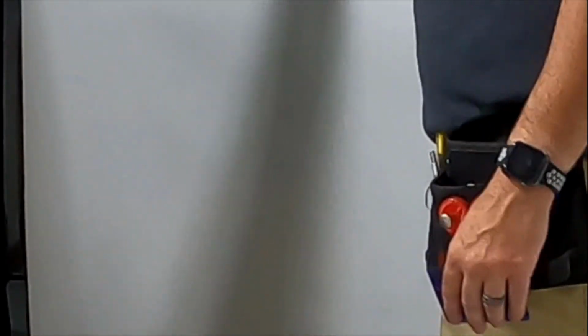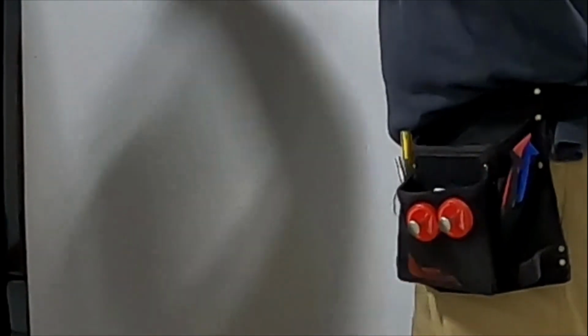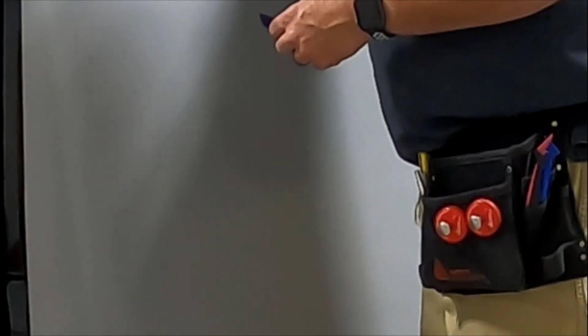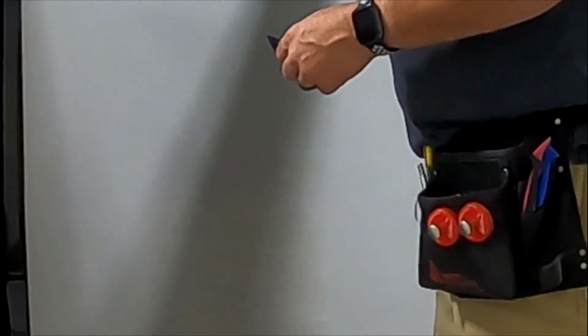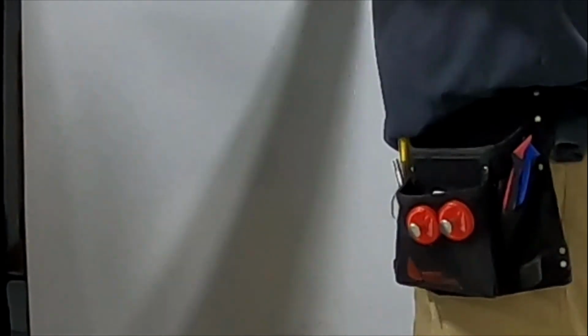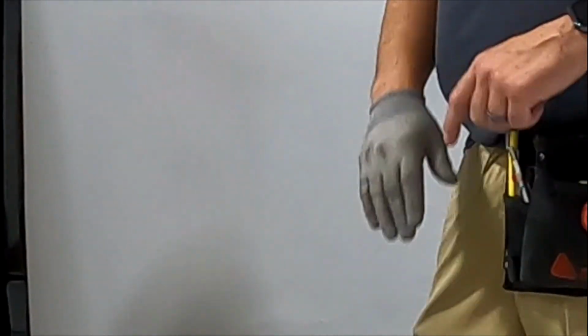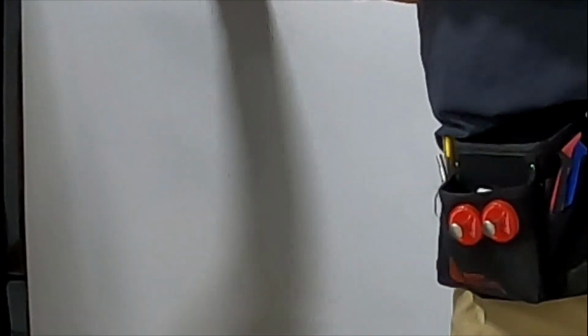And what that does is that pulls tension over all this vinyl into that groove, so you're not putting just tension of that groove into that. A lot less chance of failure. And the big thing about vinyl is getting a feel for it, kind of knowing your tension spots and everything else. I mean, if you could wrap a whole car without any tension, period, you'd be set. That car would never fail.